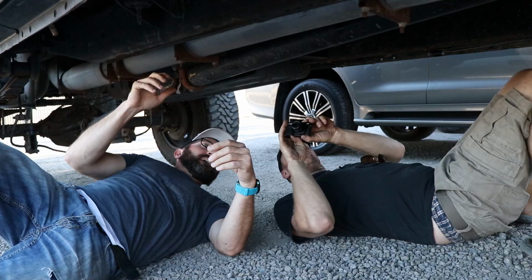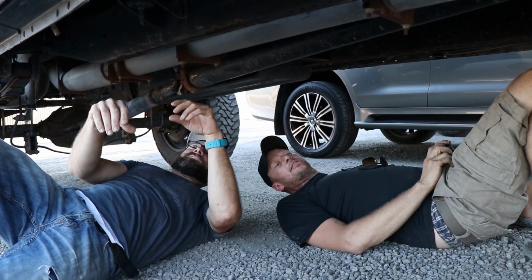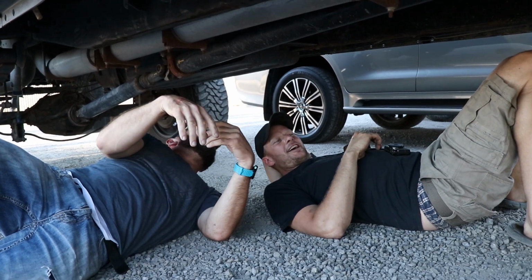Oh yeah, that was something that most people don't do, but I just wanted to stiffen the thing up because it's so freaking long. So I had a machine shop bend up a piece of C channel that will fit right inside. Right inside, nice. And then just kind of stitched it. Yep. And you don't need to do that. Other people just stitch the frames together and put that fish plate on it and call it good. Really?